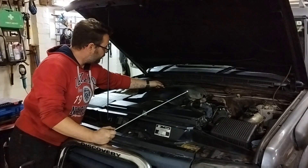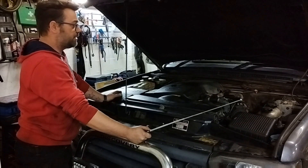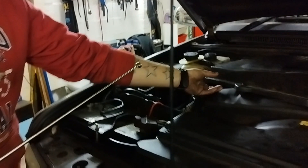Under the cover is the oil — check the state of the oil and make sure it has no mayonnaise on it, so your head gasket's okay. We've bought two now that had no air filters in, so check you've got an air filter — it just unclips, have a look. If there's no air filter, it's a sign it hasn't been looked after. Also check the size of the battery — make sure it fills the battery tray, because a lot of people put batteries in that are too small. Under there is also the ECU.